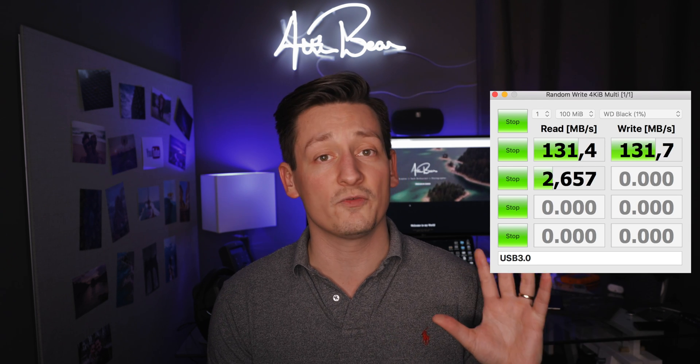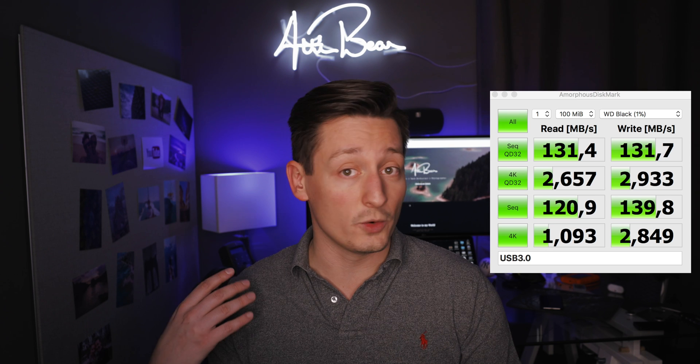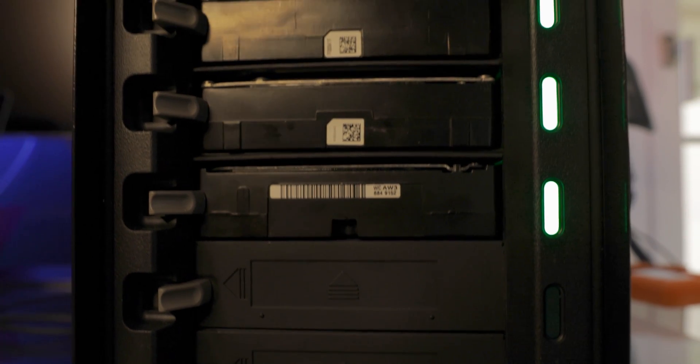To make my review more relatable, I'll give you an overview of the drives I used. I used three one-terabyte drives spinning at 7,200 RPM, topping out around 130 megabytes per second in both read and write performance. The Drobo 5D3 focuses on customers who don't want to worry about settings or configuration. You can install every hard drive without additional tools, and the moment you install your first drive you're almost good to go — you can set up the Drobo with just one drive in its bay.